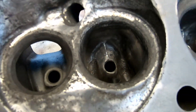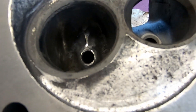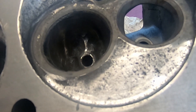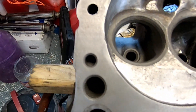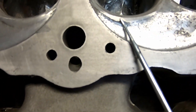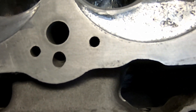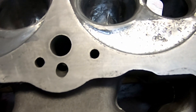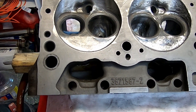I know these seats look terrible, and I'm zooming in on them so Ed can see them closer. I have sent him pictures, and he's confident that it's no step for a stepper, so he will be the man on that deal. I also knocked this down less in the chamber because he explained to me that when he cuts the new seat and it goes in, that's actually part of the seat sticking up. So he does not want me to cut that down — if it needs to be cut down, he can do that later.